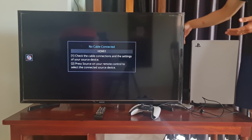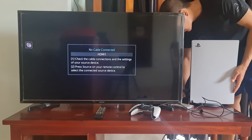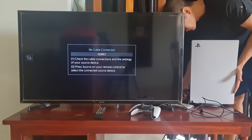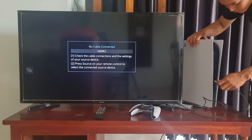You have to wait around 5 minutes when you power cycle the PS5. After the 5-minute period passes, plug the PS5 power cord back into the power outlet, turn it on, and wait for the PS5 system to prompt you to attach the controller. Connect the controller via USB and turn it on, then check if your PS5 still gets stuck on the connect controller screen.